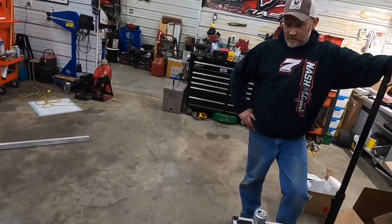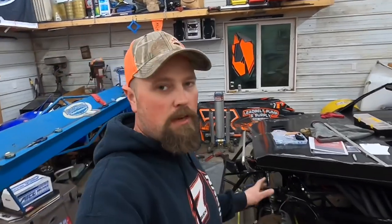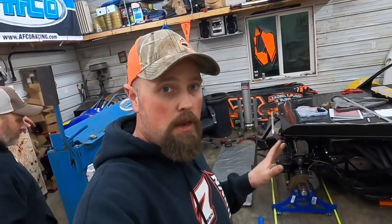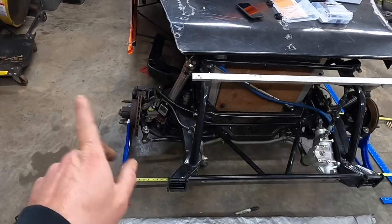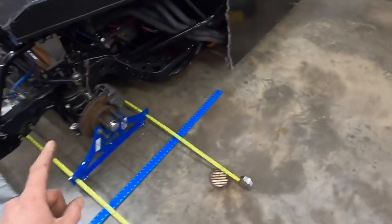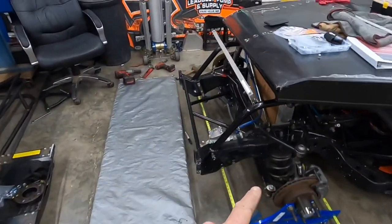After about three weeks later — many many minutes — we had to figure out how to square this up. We came up with the best solution for us. I don't want to show you guys something half-assed so I'm not going to elaborate on it, but we finally got the front end set up. This one here is square with the world against the chassis and we toed ours out — our manufacturer says three-eighths of an inch — so this is toed out three-eighths of an inch. If it weren't for these setup plates we wouldn't be able to do any of it.